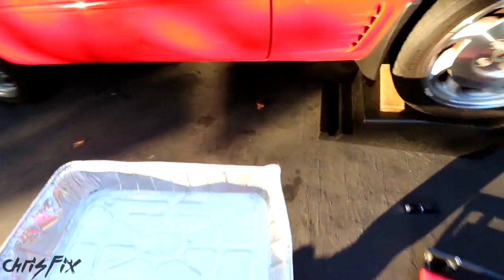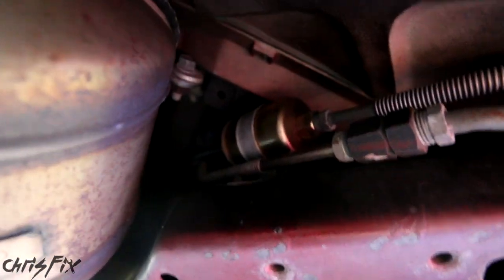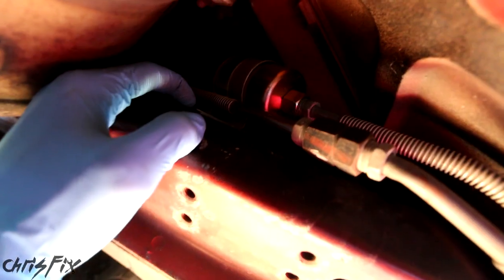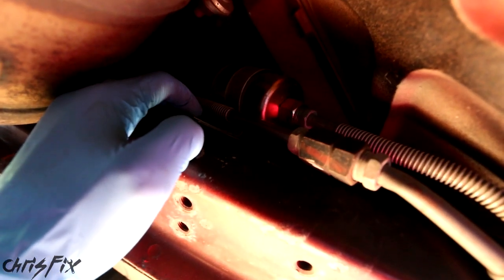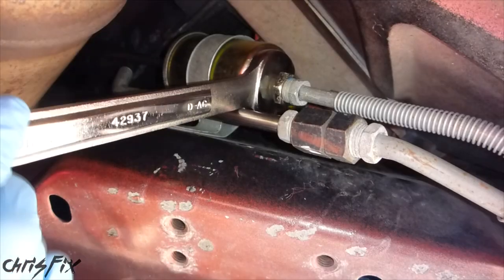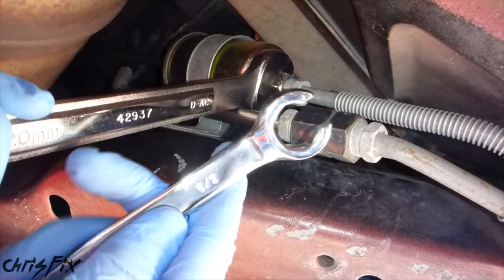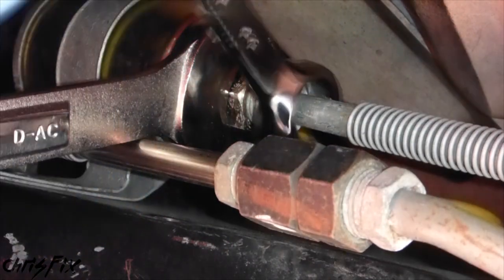For the Vet, the fuel filter is right under here on the passenger side. Get our drip pan ready — that is the passenger front tire right there, and if you look right behind the tire the fuel filter is right up there. This fuel filter is clamped in, so the first thing we'll do is remove the fuel line from the filter and the clamp will help us hold the filter in place. You'll need two wrenches: the larger wrench goes onto the fuel filter itself, while the other wrench — in this case I'm using a flare nut wrench, which if you have one definitely use it, it'll prevent stripping — goes on the flare nut on the fuel line.